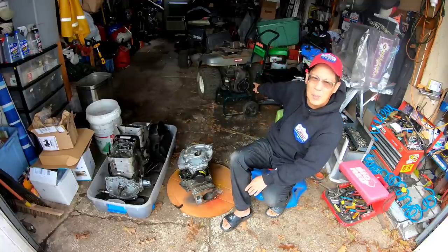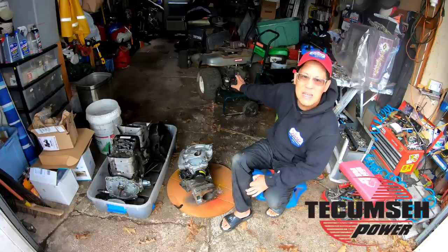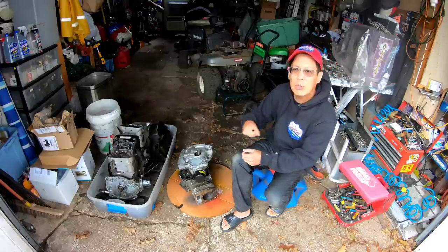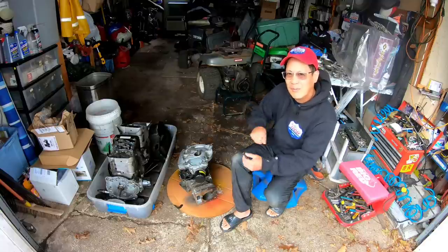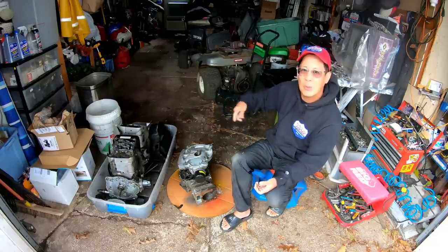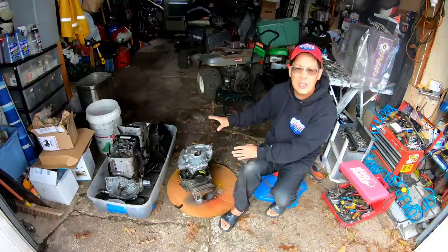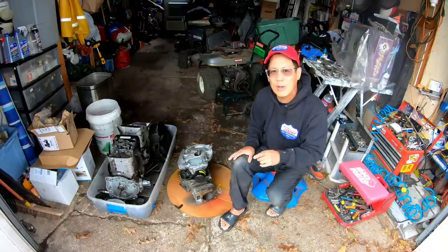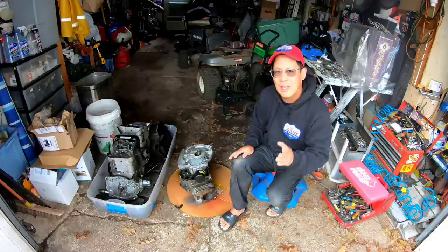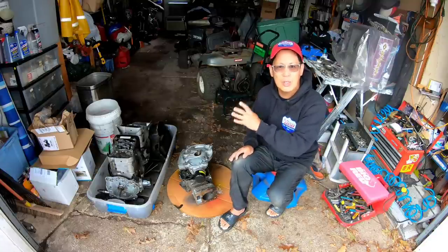As you recall from a previous episode, I had a small 3.5 horsepower Tecumseh Craftsman edger engine that I actually got running, and it was running pretty well until I was removing the pulley from the crankshaft. I think that from all the banging trying to get the pulley off, I might have cracked the connecting rod. So right now it has no compression and it free rolls. So I'm going to be taking apart four engines today, actually five. The fifth one is the opposed twin engine I got for free, that's right, free, from a local guy here in East Northport. He had a blown opposed twin and was going to throw it to the curb. I could use the tins to maybe build an opposed twin engine in the future.